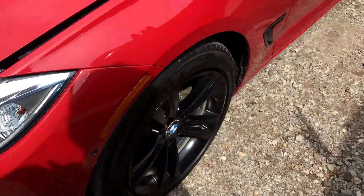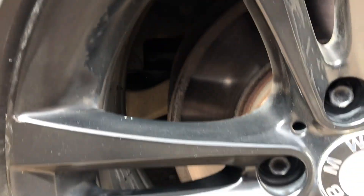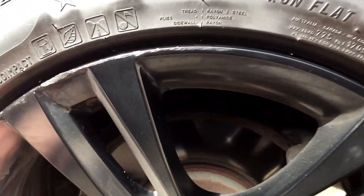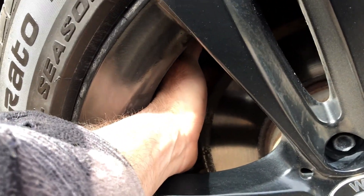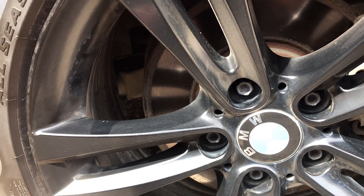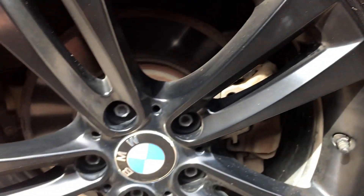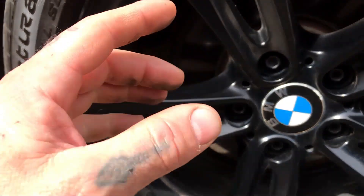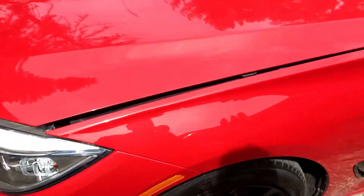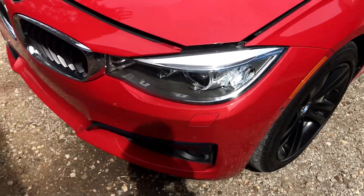Normally people start by taking the wheel off, and some might go 'hey those aren't too bad.' But if you feel on the backside you can feel the grooves, so obviously that ain't no good. A lot of times people will just hit the reset button and reset the brake indicator when they go to sell it - oh yeah, they don't need nothing.